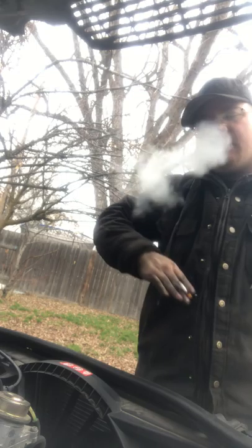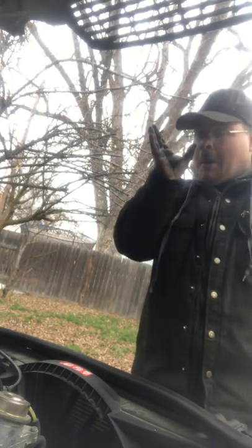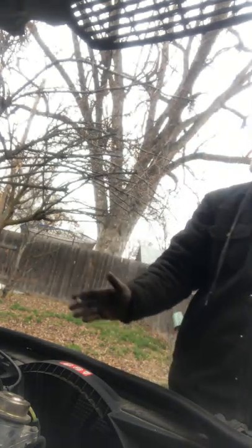Okay, slide that to the side for right now. Get my little ratchet wherever I put it. There, it's always right in front of you. I'm just gonna take off my coil packs, slide them to the side, clean up that valve cover, take off all the old silicone from the top, and then I gotta prepare for the valve cover on this side, which I have to take off, slide everything out of the way.